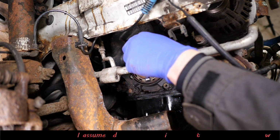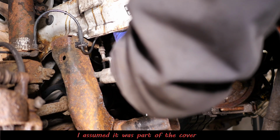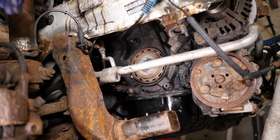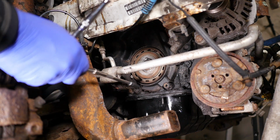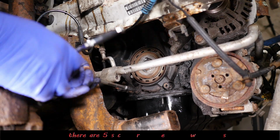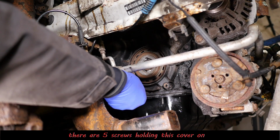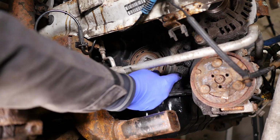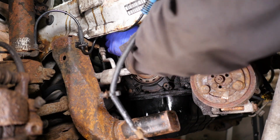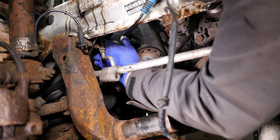I'm actually removing this one, and it actually doesn't need to come out. Not at this stage anyway, that's not part of the cover. That just holds the, it's like a protection piece of plastic for the timing belt. But these screws do have little rubber O-rings on the back of them to actually keep them in position, so they shouldn't actually come out all the way. Now it does get quite awkward there, because you've got to try and get your hands up into there, and it's quite awkward